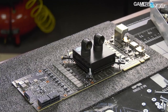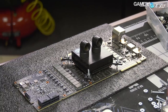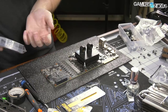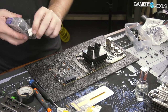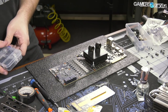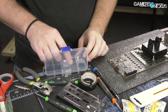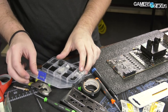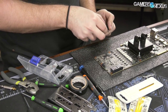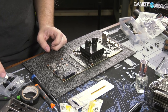We need some heat sinks for the memory. This VRM, as discussed in the previous content and in Buildzoid's analysis, is fine - it can run without anything except air. The ASUS VRM can run probably without even much air. We really don't need to do much here other than get some airflow on it, but we are going to get some heat sinks on the memory because it's getting hot under heavy overclock. It will also reduce the amount of airflow we need in a given area.